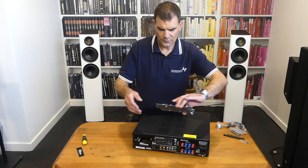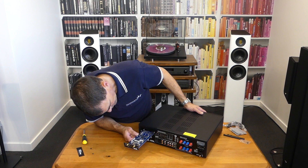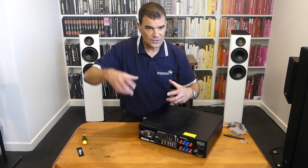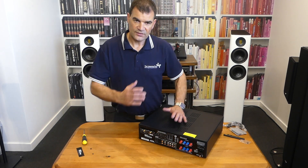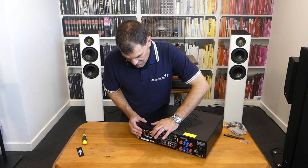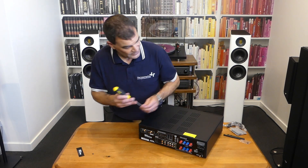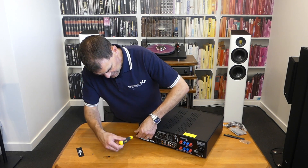Sliding it in is relatively straightforward. The first thing to do is simply line it up with the preformed slots, then carefully slide it along — there should be no resistance. If there is, you've got it in the wrong direction or on the wrong angle. Then there will be a firm stopping point as it reaches the socket it's going to bind into. Using two fingers on each side, firmly push, and you will hear a good solid click — as we just have. The next thing to do is return the screws — I'm going to utilize the screws that were originally in the amplifier.